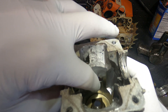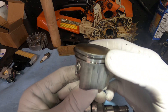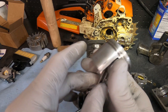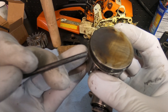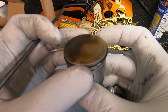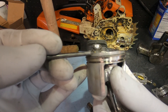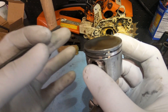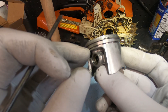Some things I want to change: we were running one ring on this, and I've been following the ring testing going on on the HF and Sawdust channel. Something he's doing is gas porting his rings for extra force against the cylinder wall during combustion. I like that idea a lot — what I want to do is gas port this piston around the edge, then scallop or chamfer the inside edge of the ring to get that same effect, but I'll do it on the piston instead of the ring. Then possibly add in a very low tension second ring.